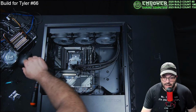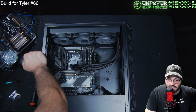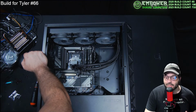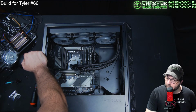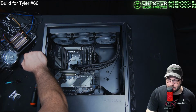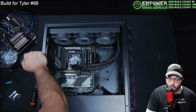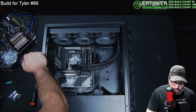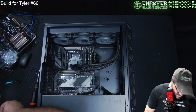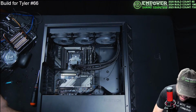I downloaded the MTK 7921 7922 7902 Wi-Fi driver for Windows 10 and 11 64-bit, and it just gave me a bunch of whatever in one folder. Now it's in my USB. So if you have that over on your USB drive, take that to your new computer, plug it in, open your USB drive, open that zipped folder, extract it to your computer or the USB drive, doesn't matter, and then run the exe in that zipped folder or that extracted folder. I don't remember the name of the exe that's going to be in there. It's going to be something Asus something.